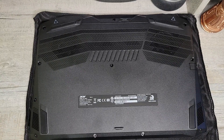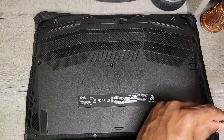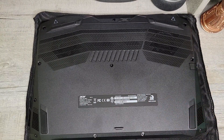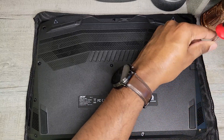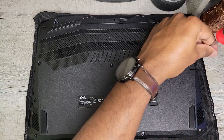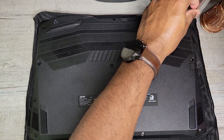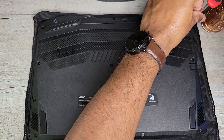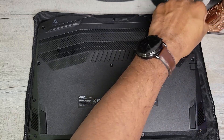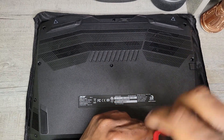You can start with any screw. I'm going to start with the ones at the bottom, as that's closer to me. As I remove the screws, you'll see I'm placing them right next to where they came out. This helps me remember where I took them from. A lot of times some of these screws are shorter and longer than others, so keeping them near where you removed them helps place the screws in the right spots when reinstalling.